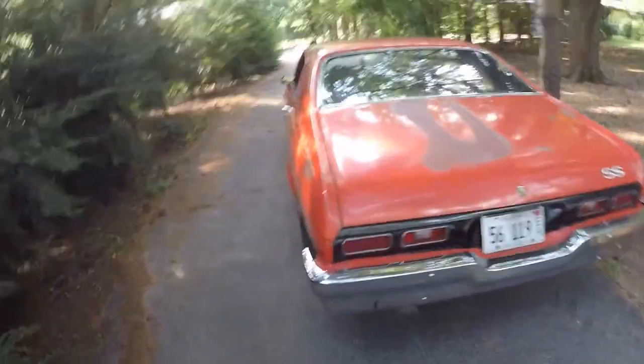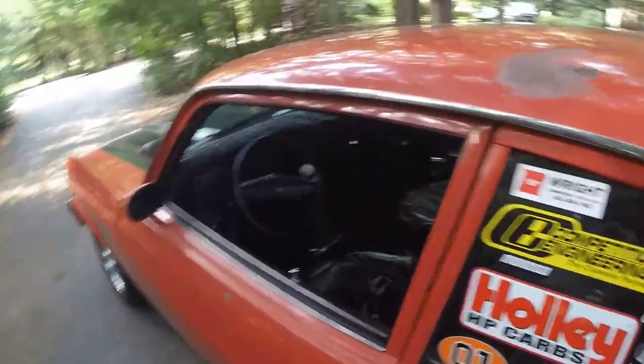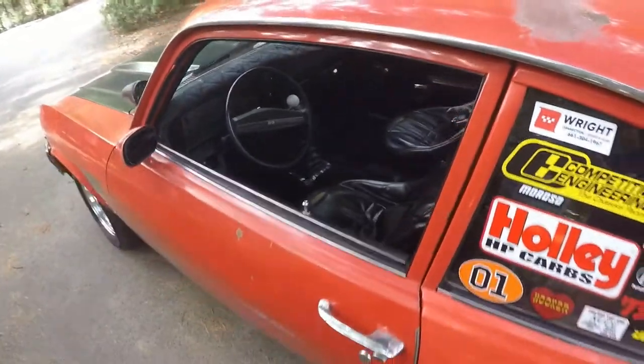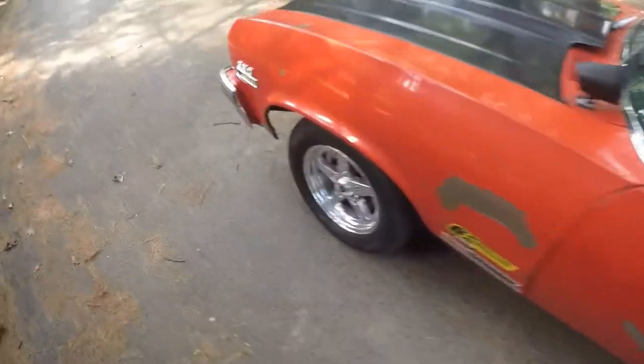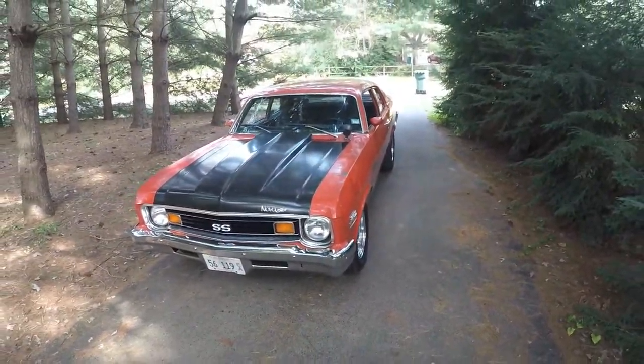For people that are looking to do the upgrade, I do a lot of cruising. A 3.73 is a little much. For a 255/60, I'm about 3,000. Here's a tach, you guys can see it in there. I'm at about 3,000 RPM in fourth gear going 55 miles an hour, and I think that's a little much. This thing isn't really built for high RPM, so I shift at 5, so I kind of feel like when I'm cruising, it's already running out of breath.